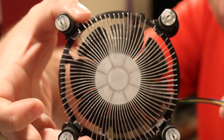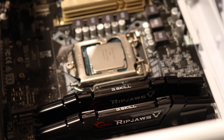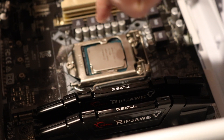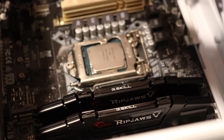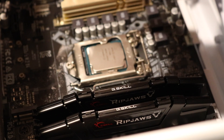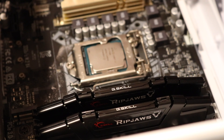I think that's cleaned up pretty good. So now I'm going to put the thermal paste on the CPU and then install the CPU fan back. There are a few ways to apply thermal paste — there's a five-point way where you put little dots kind of like on a domino. I'm going to go with just a line across diagonal, or you can make an X. Just make sure it's a light thin layer and not too much.